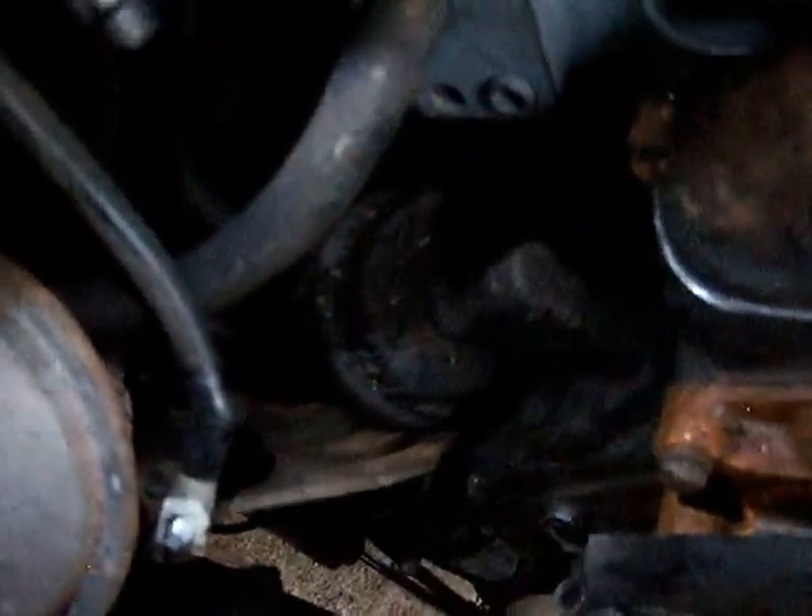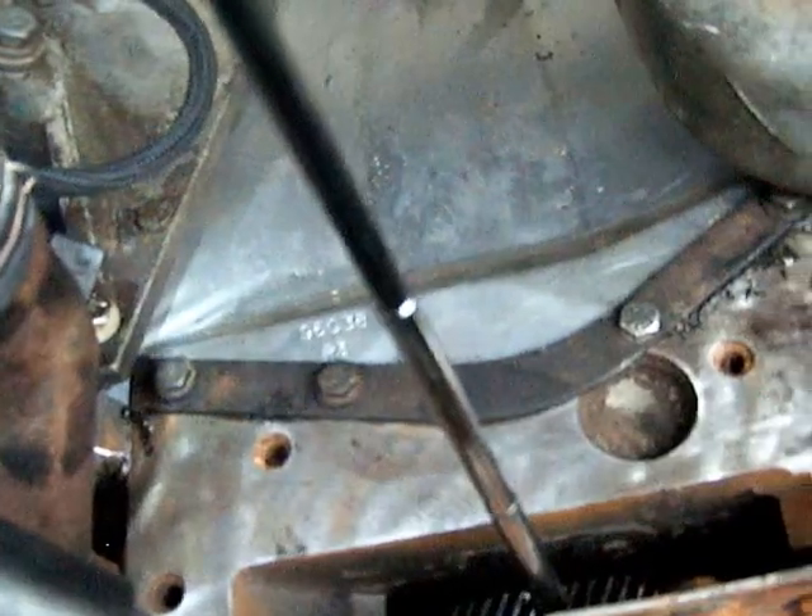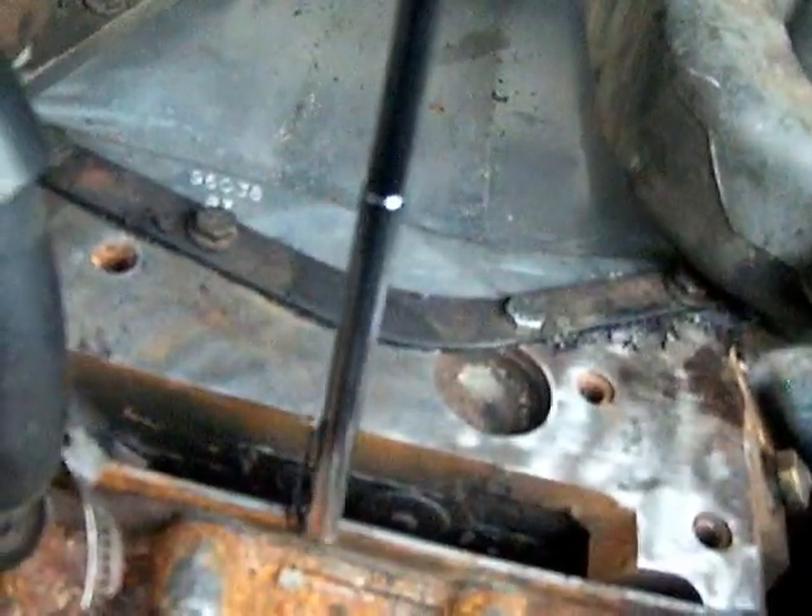You can normally get that with a small mirror and a flashlight right behind there — you gotta look in there. The way I found the Y is I lined the flywheel up on the timing mark. The small line is right there and the big line is on the balancer right there, so you line those two up and the Y is right at the top.